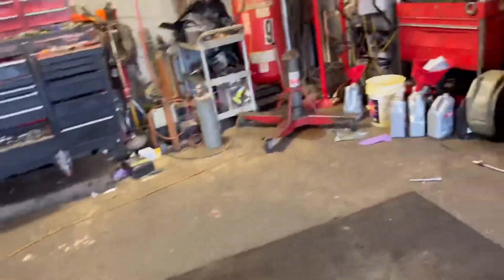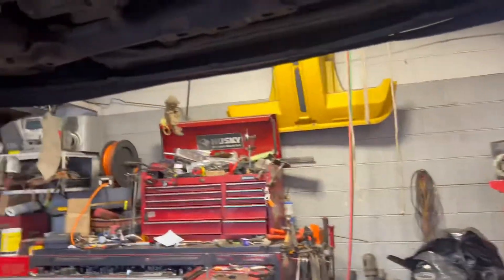You got a 2006 Honda Civic starter. First thing you do is disconnect the battery — if I got to show you that, you shouldn't be here and wouldn't touch anything else. Second thing you got to do is get this bolt out right there. Then there's a bolt up top, it's gonna sit right above here.